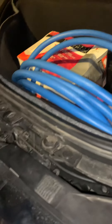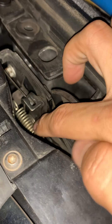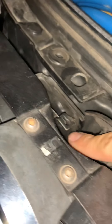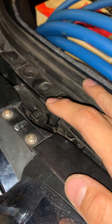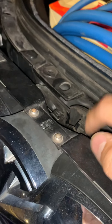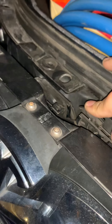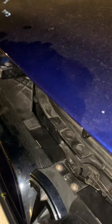The way to check if your car has the problem is very simple. Use a screwdriver to do the latching and let the system latch already — this will engage automatically as well. If you don't have enough force to push down the latch by hand or by tool, you can wait. The secondary latch will engage if the frunk is left open. The latch usually will look like this. If you close the latch, this one will go here and the secondary latch will engage. So if you do not have enough force to do the primary latch by hand, just wait until this one goes into position, then lower the hood. If you have an electric frunk, just stop it before you hit the bottom, let it land, and after you land, try to pull up.